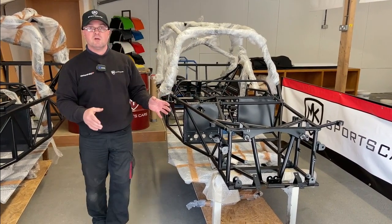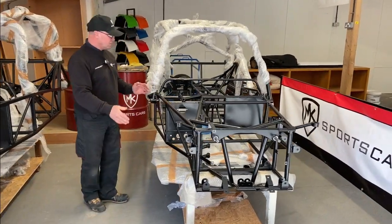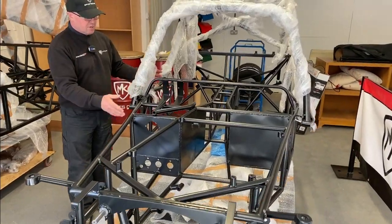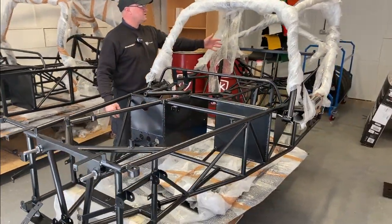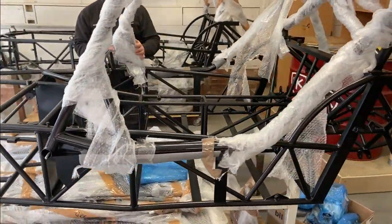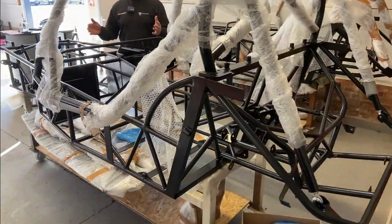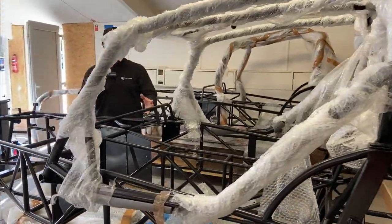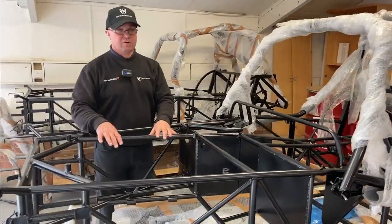With the round tube and the RR chassis, we also offer the option with the FIA roll cage, which bolts in. It's a bolting cage with a fully rose jointed rear end — a double-D hoop on the top section. It's a lighter cage; the chassis overall with the cage is between 10 and 12 kilos lighter overall as a chassis, compared to what we produce.